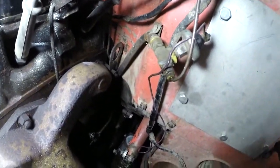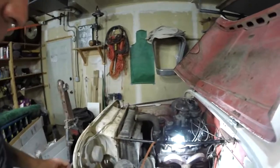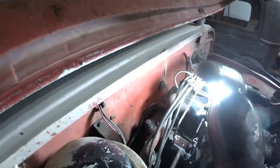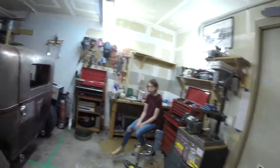Alright guys, I got it all done. Brakes are bled, don't see any leaks. What a pain, but that thing is changed. I overfilled it a touch so it looks like it's leaking out the top, but it's pretty good. One more thing — I wanted to hook up a temp gauge, and I found where it goes back here. This little wire was disconnected, so I put a new end on that wire, crimped it on, and plugged it in — hopefully my temp gauge works too. Even though it's raining a little bit, me and my trusty sidekick who helped me bleed the brakes are going to go out and hit the road and see how everything works. Thanks for following along, don't forget to hit subscribe — we'll see you on the next one.